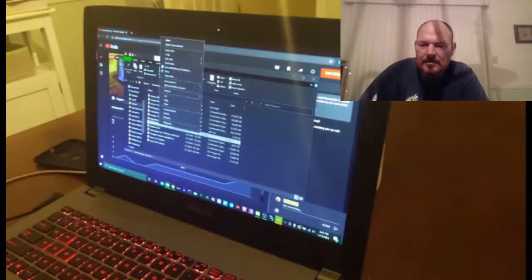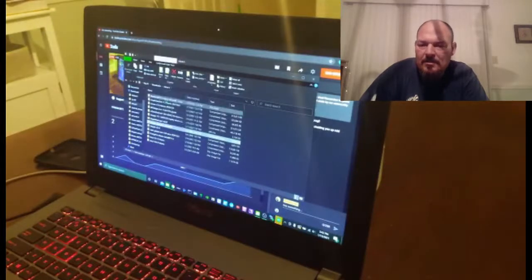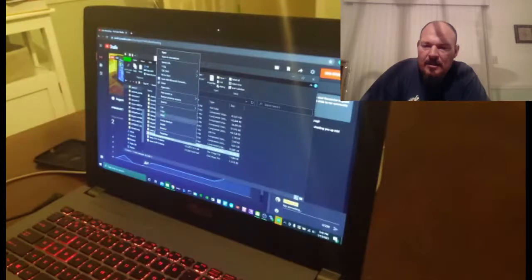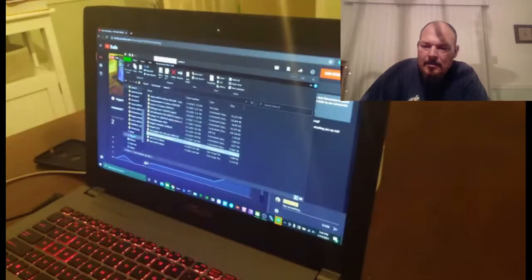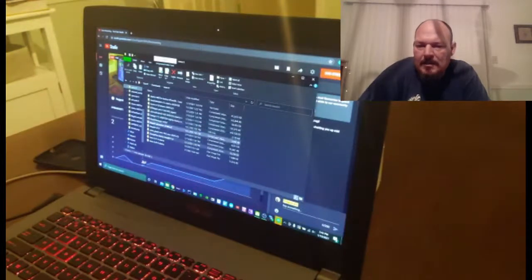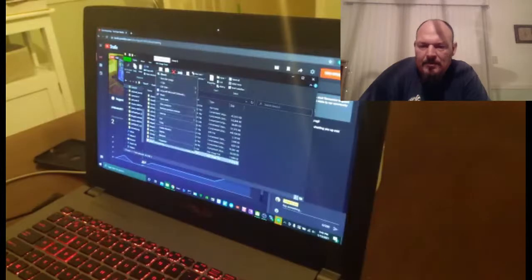So I need to copy over the uninstaller, the Magisk uninstaller, and then we'll go down, paste it here, and then Magisk 21 if I want to root it. Copy, paste, and then I'm going to do Orange Fox recovery just in case you guys really want to. I'll show you how to do that. It's not hard. And then we'll right click, paste. Get these files copied over. What else do we got here? Got the GApps, got that. I'm going to do the TWRP 3.4.0